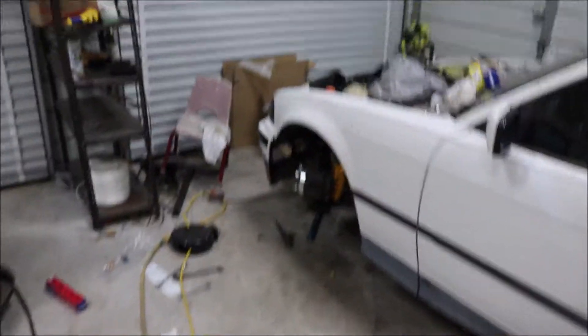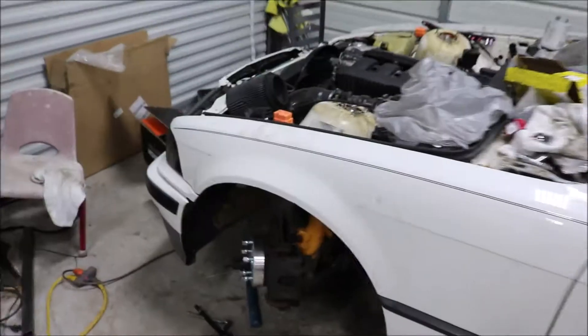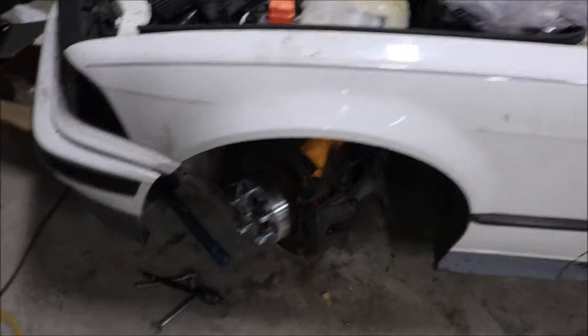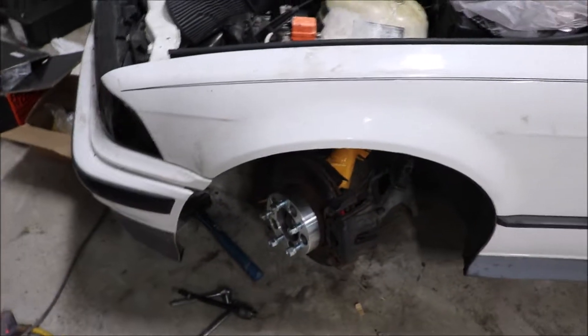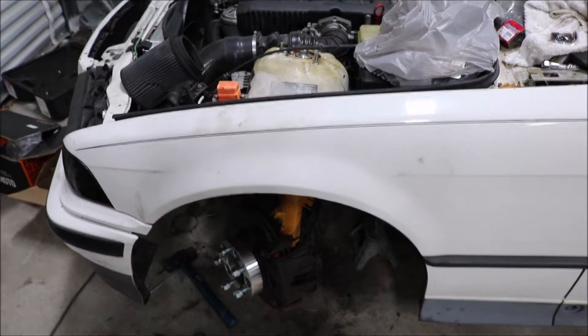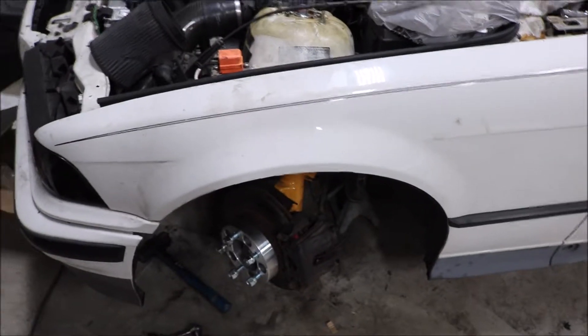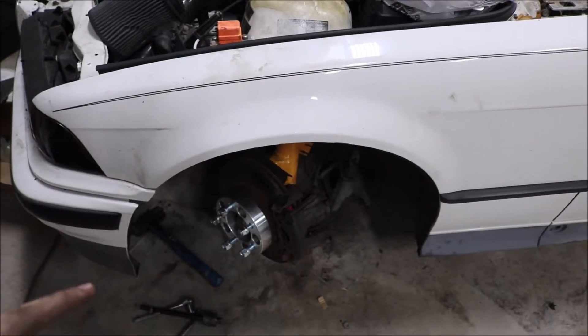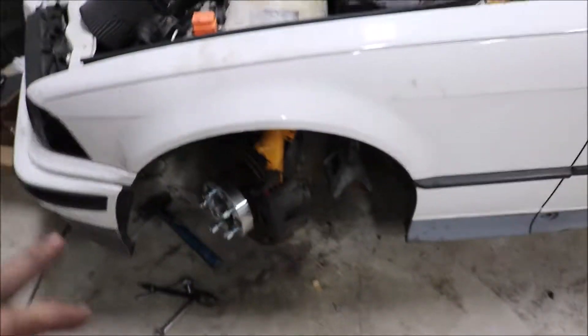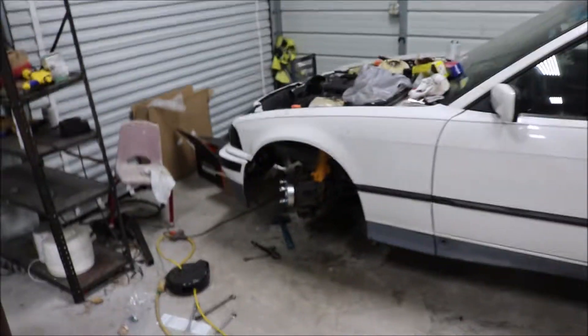We got coilovers on and spacers. The only reason I'm running spacers is to push the wheel out some more to get that tad more angle, and because BMW doesn't have studs — they have lug bolts, which is a little pain in the ass to put the wheel on every time. These are also different bolt pattern spacers — they adapt from a 5x120 to a 5x114.3, which is what the Z runs, allowing me to run a wider range of wheels since there aren't that many wheels in a 5x120.